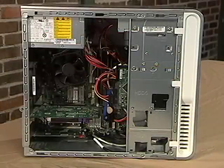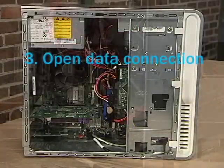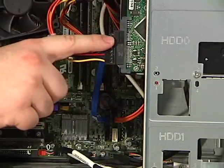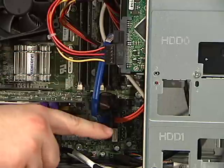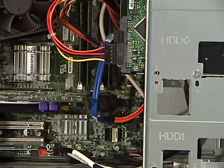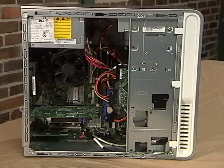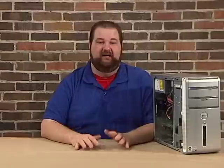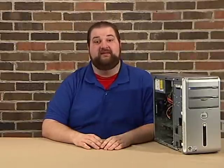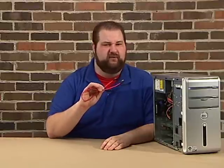So we're down to the third and final item on our checklist: do we have a data port on our motherboard that we can plug into? The easy way to find out is to start at the end of the cable plugged into the hard drive and follow it all the way to the motherboard. You can unplug the cable and match it to an open port around it. Almost all systems like this will have at least one extra SATA data port. Unfortunately, our system does not come with any data cables for an additional hard drive, but these are easy to find — I purchased one at a local computer repair and resale shop for about four dollars.